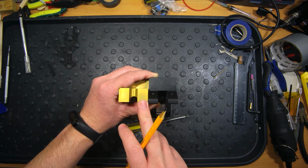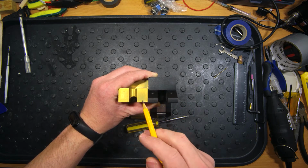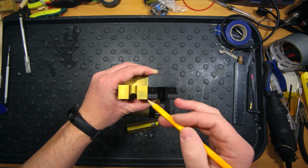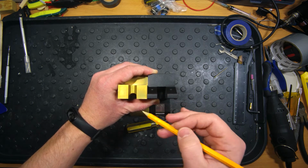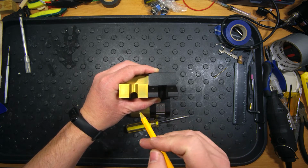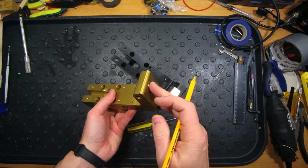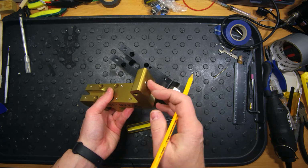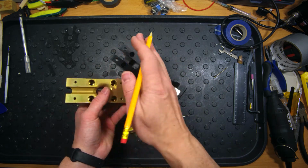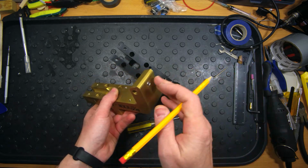You just drill new holes, cover up the old ones and reinforce the inner shell. Here we can see that the area of distribution of your EUC weight on the pedal hanger is much bigger in comparison to the stock ones. This really gives a lot of reliability to your wheel and will avoid any cracks of the pedal hanger area in the inner shell in future. And traditionally we have this premium pedal axle fixation mechanism from EUCYou, which will give you a lot of comfort with your pedals closing up and holding in the closed position without any problems, and it is really reliable.